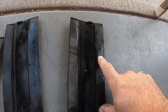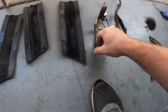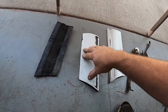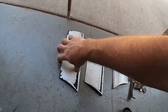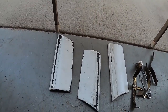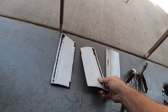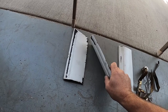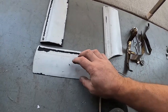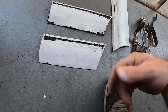So until I figured it out on the first one — you can see I did get a little warm right in here — these last two came off really good because I figured it out by then. Just put a little bit of heat on it and it'll start to lift up, or you can try to pick underneath the edge if you're worried about getting too much heat. Then what you want to do is flip them over. If they're still warm, you could probably even use a heat gun. On a nice hot summer day, set these on concrete or metal and they'll get really soft where you can bend them. They'll actually straighten themselves out. Set them on something warm, they'll flatten out, then pick them up and set them on something cool and flat, and they'll harden back nice and straight. Then you can sand them down and paint them, or if they're unpainted, just reinstall them right away.